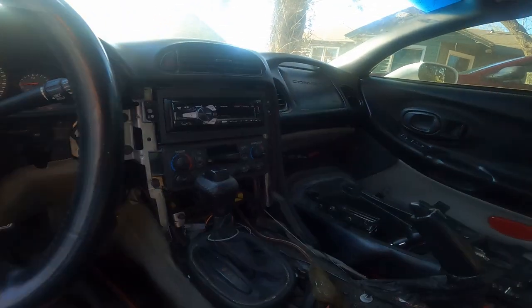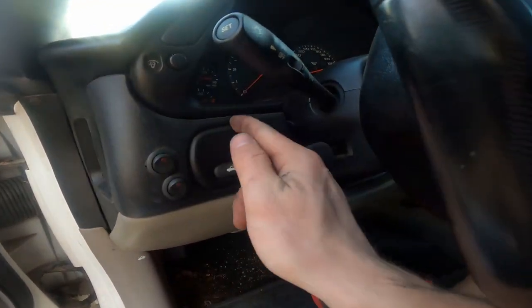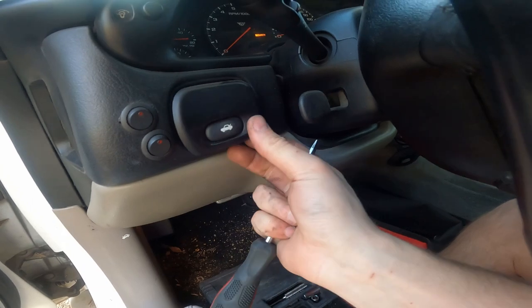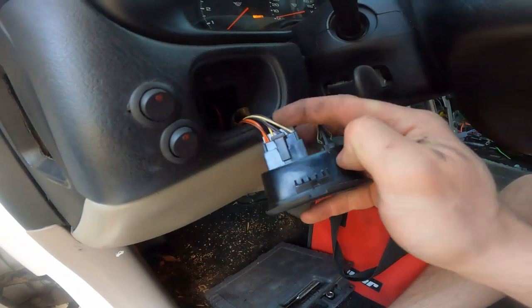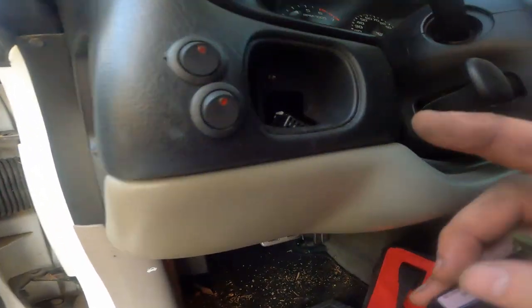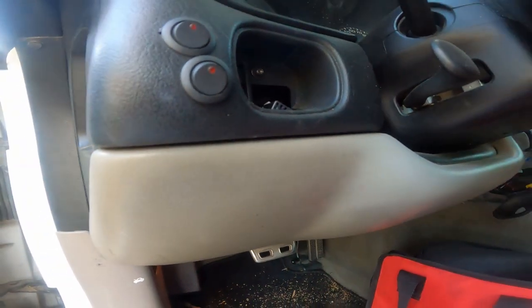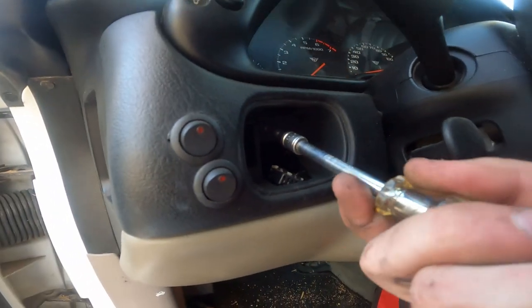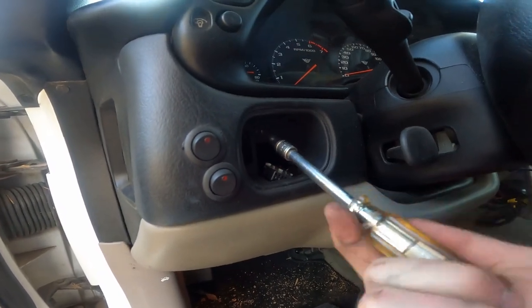Go ahead and turn the car off — put it back in gear, there we go. For the next thing you may need a flathead screwdriver to pry your trunk and fog light assembly out if you have those. Then disconnect that clip, and that reveals another torx head up there. I've got a T15 bit in my little screwdriver here because this makes it easier.